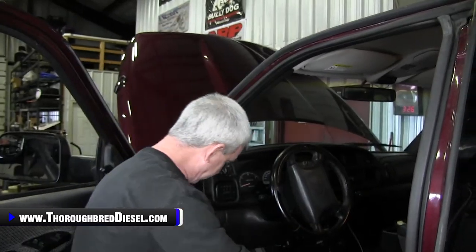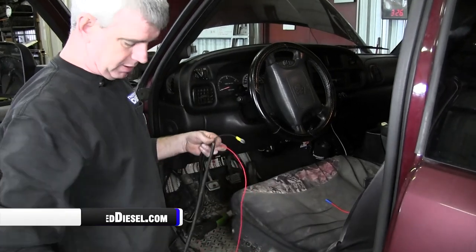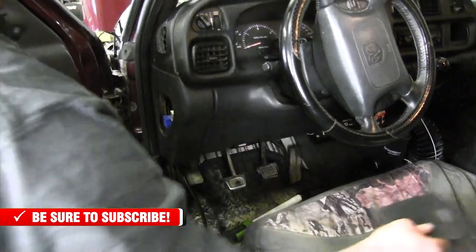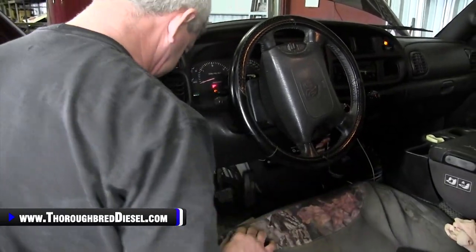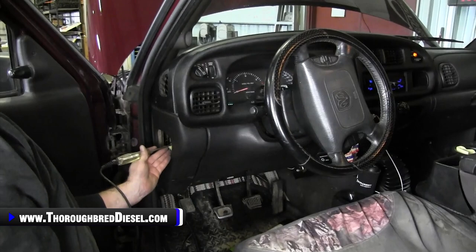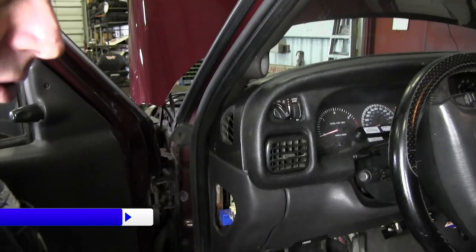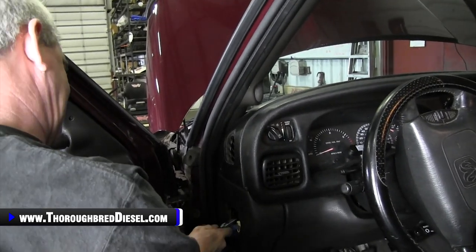We're inside the cab of the truck now and we've got our wiring harness all the way through. We brought through the power, trigger, and ground, and we've brought the light hookup in. The first thing we're going to do is find our key-on power source. We're using this fuse panel right here — the bottom row on this for the cluster is 10. Take a test light and find a fuse that shows to be key-on hot. Shut the key off and you see no power to it. Now I'm going to pull this fuse and figure out which leg of the fuse the power is on, and I want to turn my fuse holder to that side.